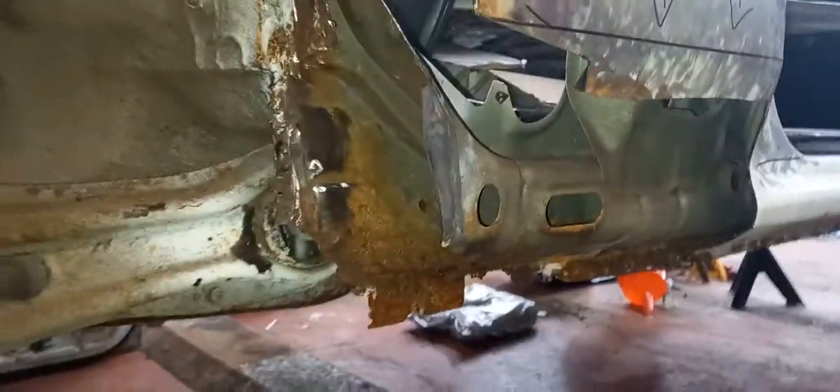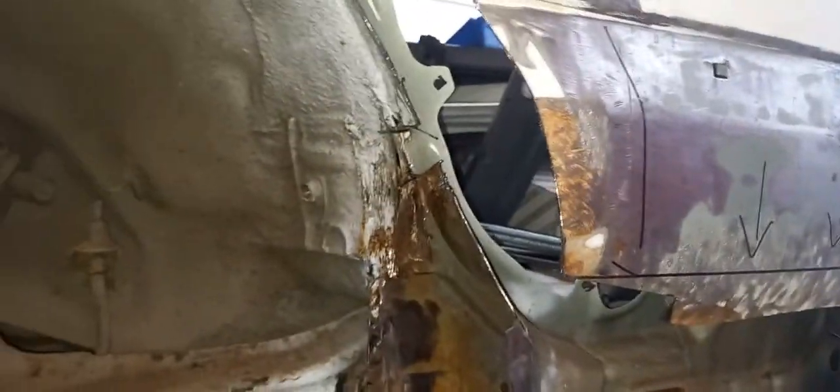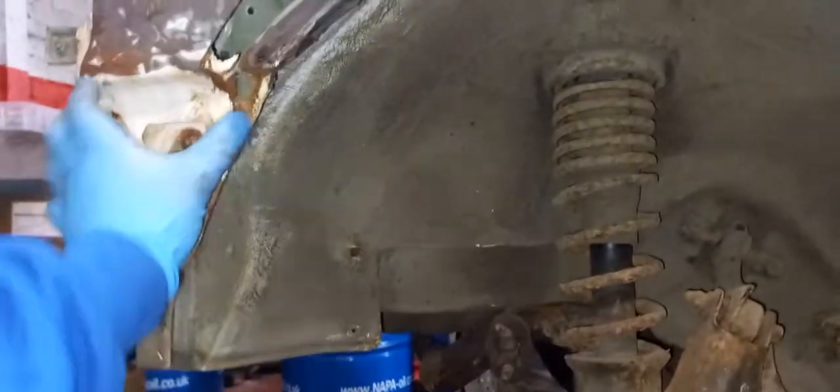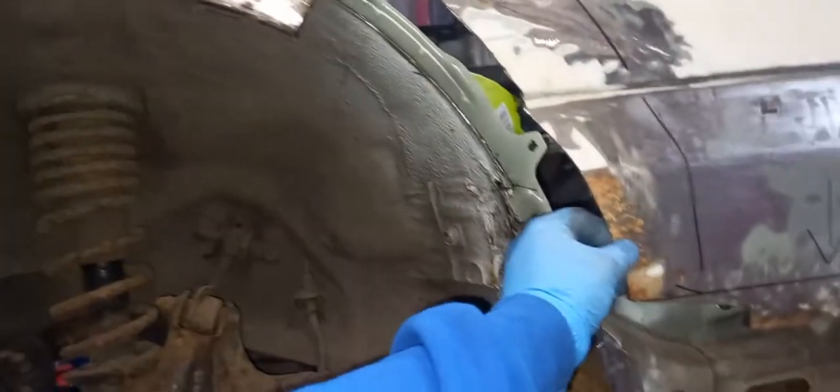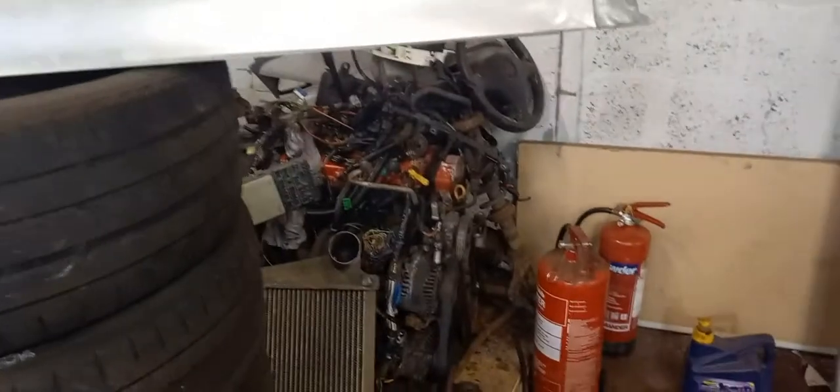To get to the back gear we'll need to get the suspension taken off it. And then hopefully we'll get it mounted onto the ramp - we can lift it up a wee bit higher. At the minute it doesn't look like there's anywhere we could put the legs under. This is where our new panel will come down to, where we've drawn it there - that's where we'll cut it. We've just kept as much metal on it as we can and we'll trim it to suit. As Ed China says, I'm sure a lot of fettling. We'll get the sill on it and then start worrying about that big lump of engine.